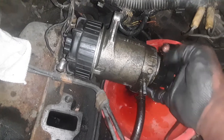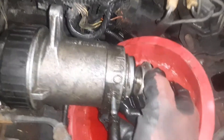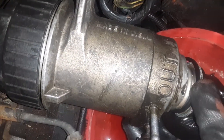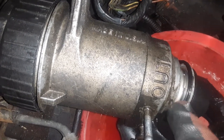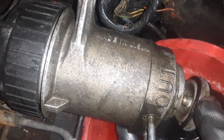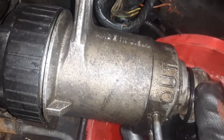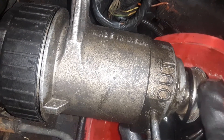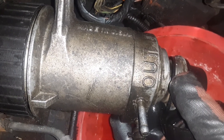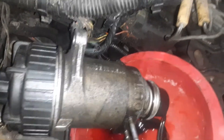Then you can pull it right out. I'm gonna try to get up here as close as I can so you guys can actually see the ring. You see the ring right there — that is the failure. What I'm actually pulling out is the heating element for the housing, but that right there is your root cause of the leak when you see diesel on the top of the block. Hope that helps you guys out until the next video.